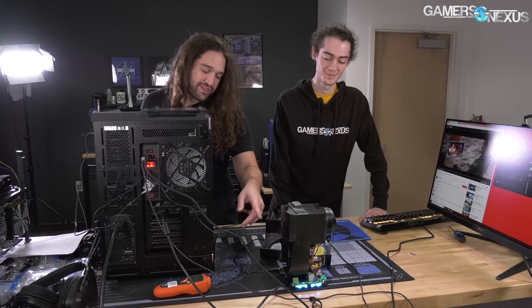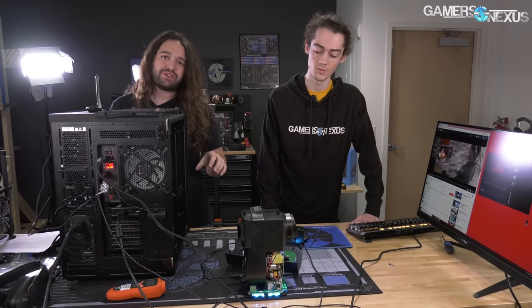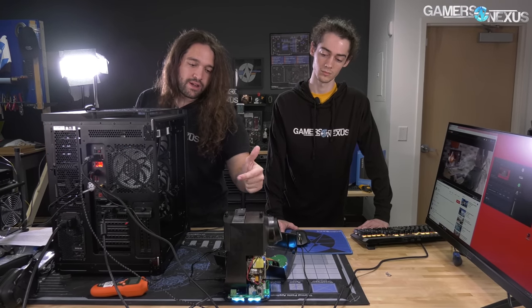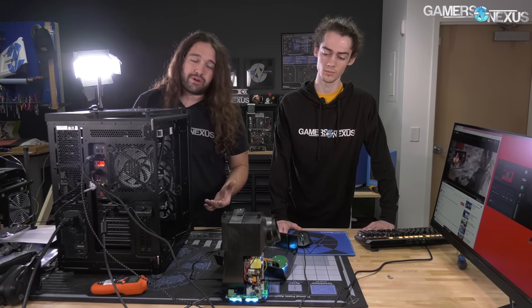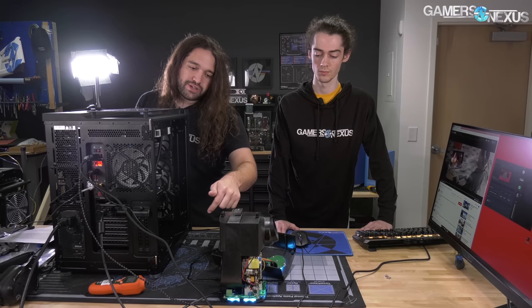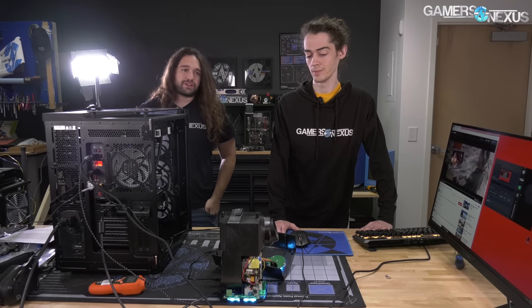So there's a motor on the back that might be that. And then Andrew noticed earlier that the LED is pulsing when there's no other noise, and it does make a bit of a whine. So that might be coil whine. And then you spotted a thermistor in here. Mm-hmm. So a thermistor is like, EVGA uses them on their ICX cards. They use 9 thermistors. It's just a thermal sensor. So there's one of those in there touching the plastic. Yeah. Which is probably the least useful place to put a thermistor for temperature measurements.